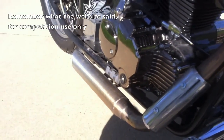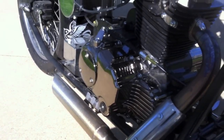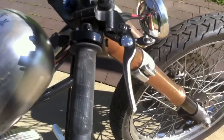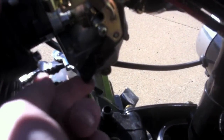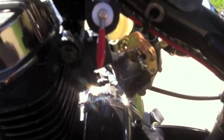This exhaust is quite loud, but that's the way I like it. I cleaned up all the controls up top — even the start switch. I put a dirt bike throttle tube on it, and I moved the start button down here. The key turns on the headlight and tail light — there's no high beam or anything — and I just press this button to start it. For the choke, I'm going to do a three-position choke instead of the wire-actuated choke, since I removed all the controls up top. It'll just be a click-click-click — a three-position choke on the carburetor.